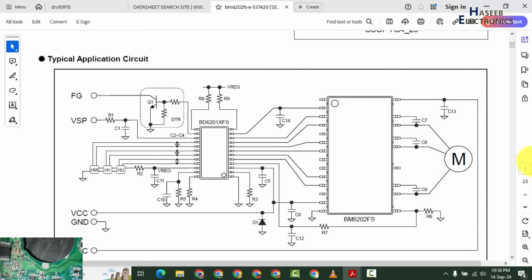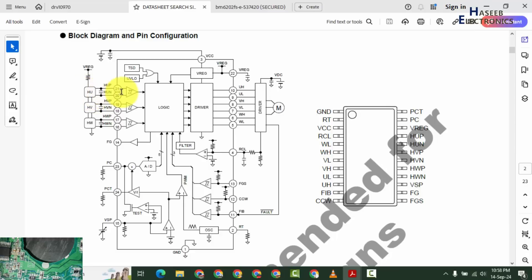WH and WL are for the third phase. Three-phase drives are provided to the driver IC, and it will switch and drive the motor. The hall effect sensors are connected to comparators — there is logic that will define the position of the rotor. The FG signal is the output signal from this IC; it will provide information to the indoor unit main control board that the indoor fan motor is spinning.